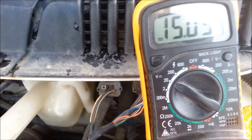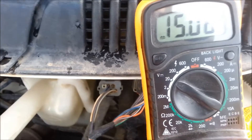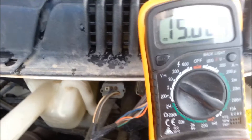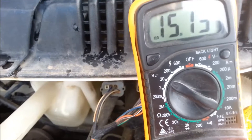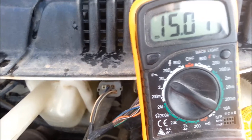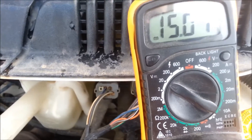If it's going under 13 or 14 volts, then you know you've got a problem. If it's going over like 16 or 17, then you know it's overcharging — you'd want to take the alternator out and get it tested. But to test your charging system, this is the way you do it with the digital multimeter.